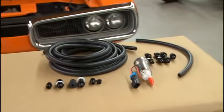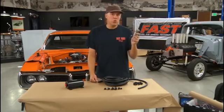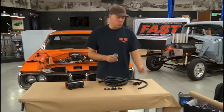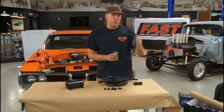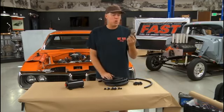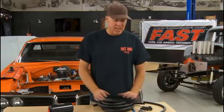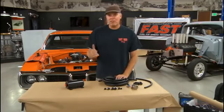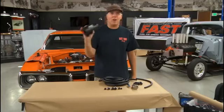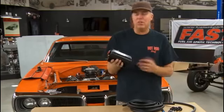There are three fuel pump setups you can do with the Easy EFI. The most recommended is the in-tank pump — it runs cool because it's submerged and sealed in the tank, and it comes with all the fittings, push lock connectors, special rubber hose meant for submersion in gas, and a whole bunch of rubber plumbing. They say it will support 1,200 horsepower. They also make an inline version if you don't want to get into your tank. My car has a full race pump similar to those, which supports all kinds of power, but with that one you're on your own to come up with the extra fittings and hoses required.